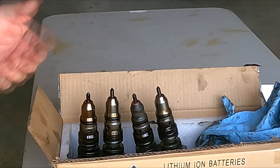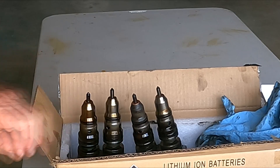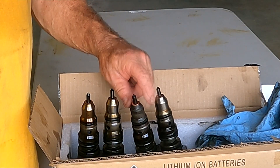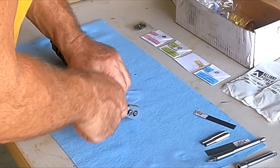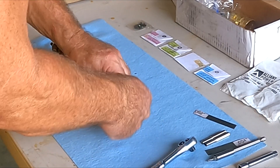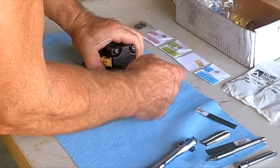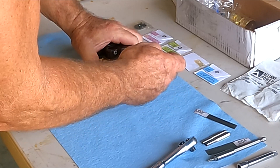Here's a view of the passenger side injectors. The third one back again looks kind of funky — the o-ring was dead again. The others looked fairly okay; didn't look like there was any blow-by or anything leaking there. Anyway, in doing the o-rings I also decided to do a shim kit on the injectors.